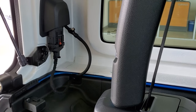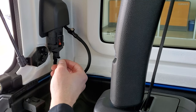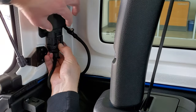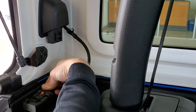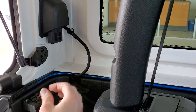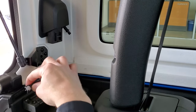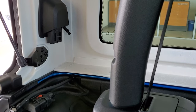The last thing before we can enjoy the open-air world of the Wrangler is to remove the two quick disconnects. The first is the big one — there's a little red tab, push down on that and it'll click, then press the red tab in. I like holding the top and pulling down on the piece. There's a spot below for this connector to click into and hold. The second one is for your washer fluid — press the silver tab in and it slides right off. There's also a spot for that to store, and now we're ready to take the hard top off.